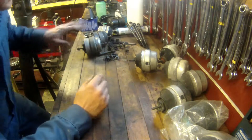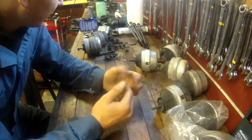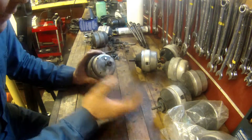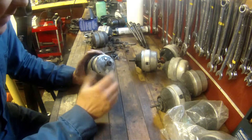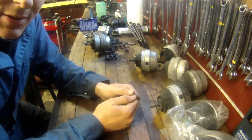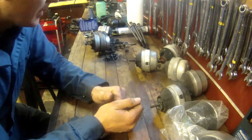Something else to look for: if you've purchased a car and don't know its full history, have a look underneath. You have to take the mount out of the car to figure this out, but you'll be able to see if the base of the mount is twisted — even from abuse, like if the previous owner was launching the car all the time. If the mount has lost its oil, there's a good chance the motor was moving around a lot and could have bent it.